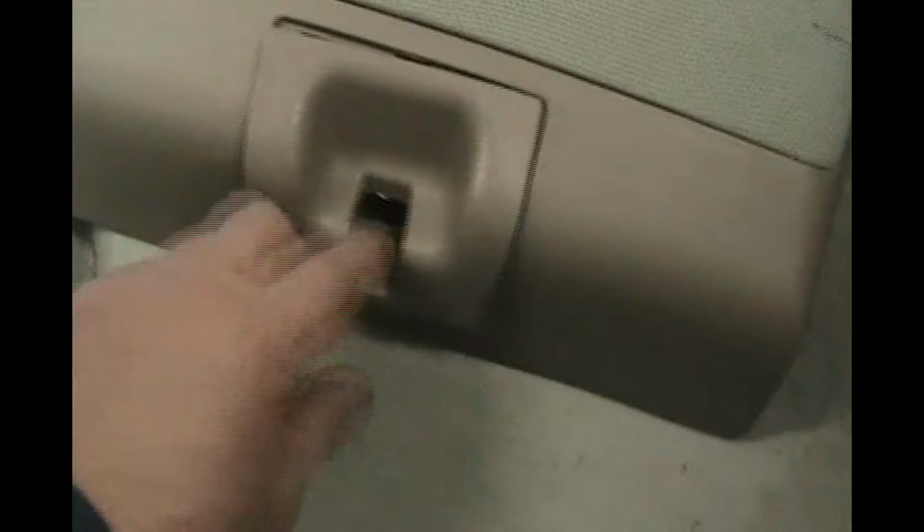Okay, you want to pop this cover off first before you go inside the car. Just on the back side, give it a real firm push through there and pop that out. We're going to put that in last because we need clearance for this thing to go over the child restraint hook. So get those 2 clips in the back by the glass lined up, and then give it a push. All we did was push down.